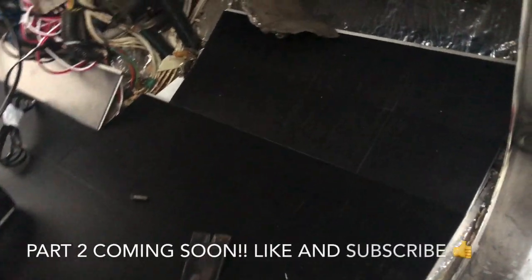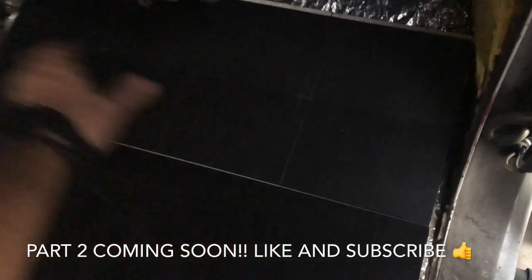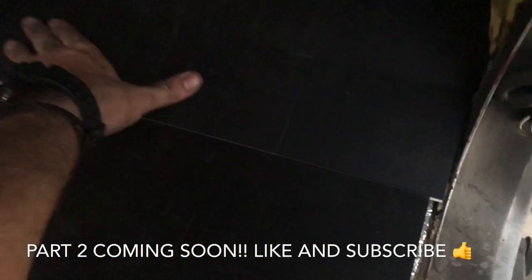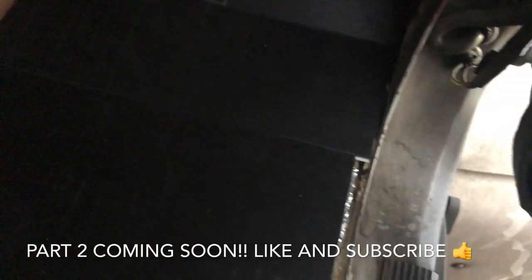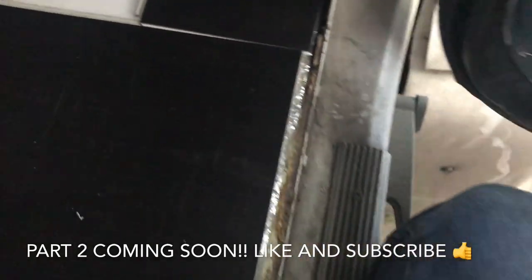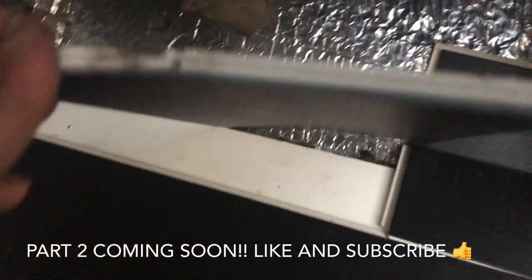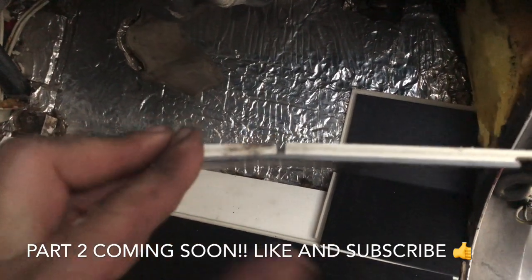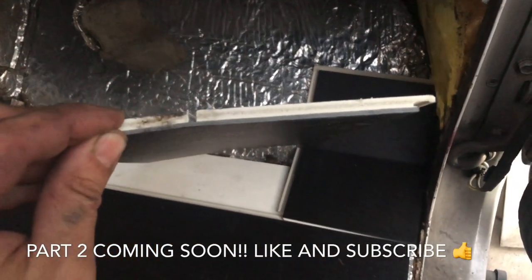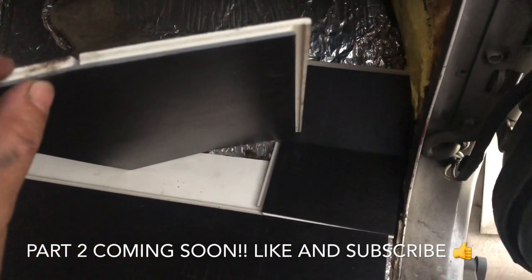We're almost there, guys. I just want to show you a little hint, a little clue, a little tip, whatever you call it. Here is where the floor is gonna start raised. So what I did, I just scored it on the back. Let me show you. Right there, but I didn't go all the way through. You can actually see. I just did the PVC, but the actual vinyl is still intact. And you just bend it and it should be okay.